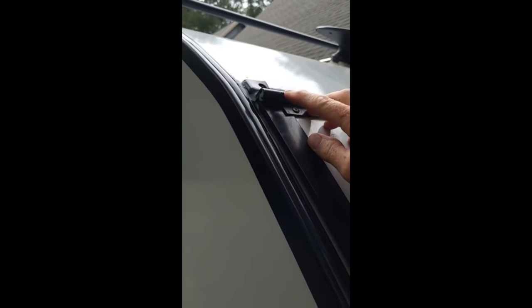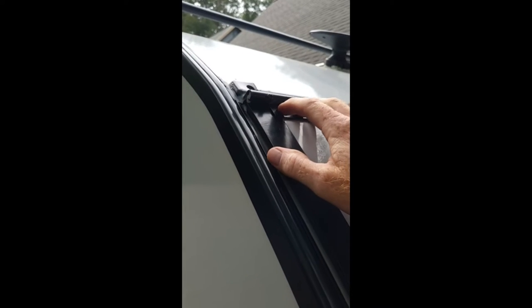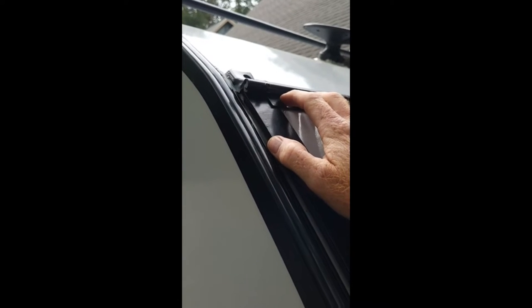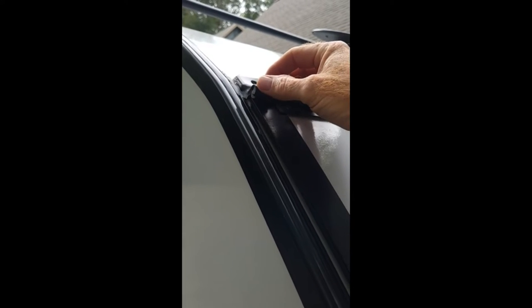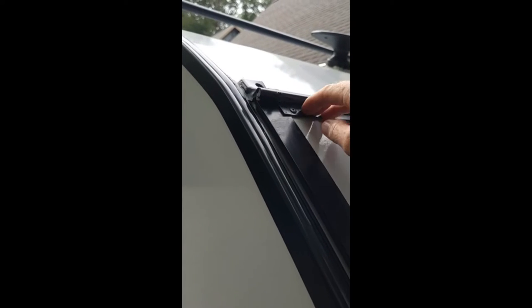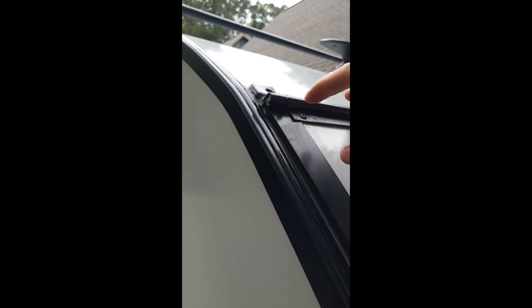What we're going to do is remove these stop screws and just throw them away because they're not necessary, and we're going to drill off the factory lower hinge section and then replace it with a new hinge section that I bought from RecPro — I'll put a link to it in the description down below — and cut that section so that it is the full width of the upper hinge section. Then we're going to notch the lower leg of the hinge, which will keep the upper section intact and keep that gutter channel working as it's designed to but still allow the door to close.